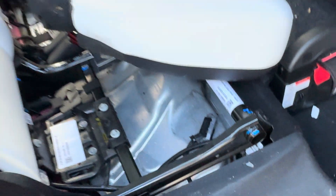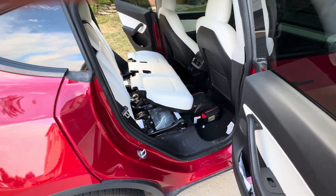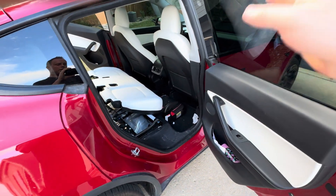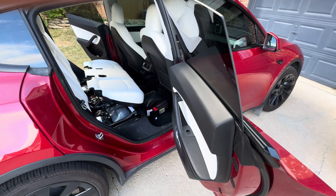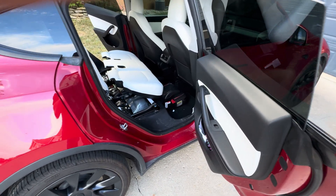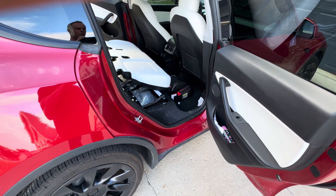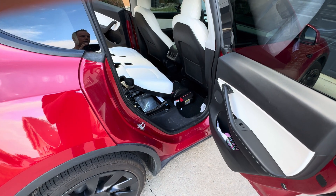Then you take this plug and you just literally lift it right off and unplug it. You have to leave the car sit for a minimum of three minutes. The Tesla is going to make some weird noises — it's going to sound like it's going crazy and it's going to have all these error messages on the dash, and you're going to think you did something wrong. You didn't do anything wrong, trust me. Leave it for three minutes — I left it for five, literally set a timer on my phone. Then I plugged it back in — boom, problem solved, problem's gone away.